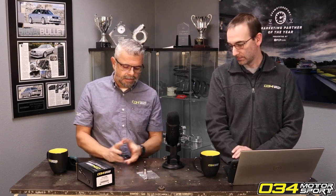We sell our Stage 1 Plus and Stage 2 Plus files for $50. So if you're currently on Stage 1 or Stage 2 on the B9 3.0T and you'd like to go to One Plus or Two Plus, you just need to buy this pump, do the upgrade flash, and unlock that extra power — it's just sitting there waiting. We also came to market at a very affordable price. Some other options are around a thousand dollars and include a whole new pump housing. This is quite easy to service and we sell a very affordable tool to go with it, making this a DIY project.